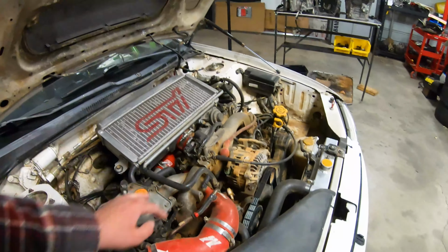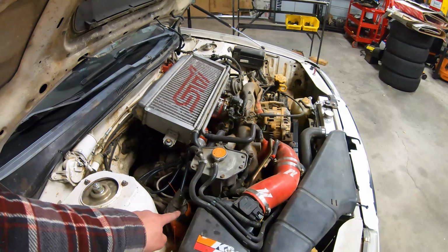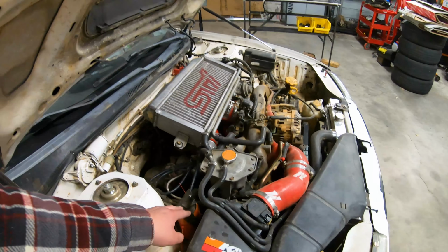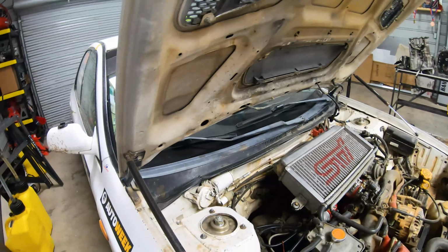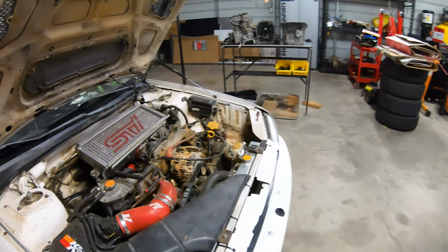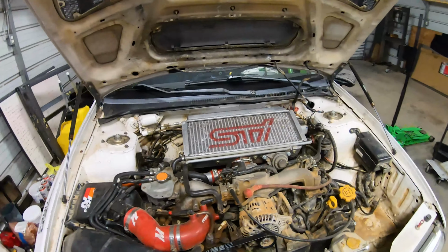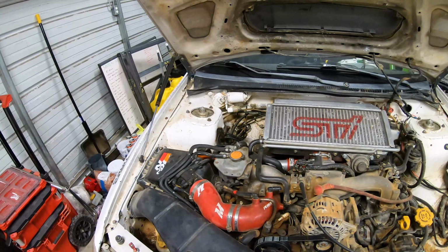We also checked the PCV hoses, and sure enough, it was just a little bit of blow by. Almost nothing came out, just a light mist. But just routing that and getting some of it out of the intake tract to cut down the smoke while we're driving, now it just has a little bit on startup. But we'd already leak down tested the motor and everything, so everything's good there. It's just a built motor and it has a little bit of blow by.